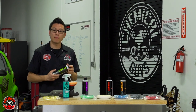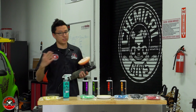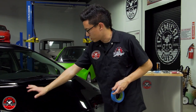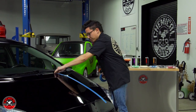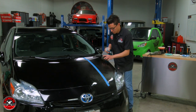Just in case you're wondering how much better we can get it, I'm going to bump it up to V-34 on the other half of the hood on one spot to get a reference and see how much deeper we can cut to remove the very deep swirls and scratches. If V-36 didn't work, we'd try V-34 on a cutting pad or go up to a more abrasive pad. I also need to decontaminate this part of the hood first since it's still rough and contaminated — same clay block and clay lubricant combo.